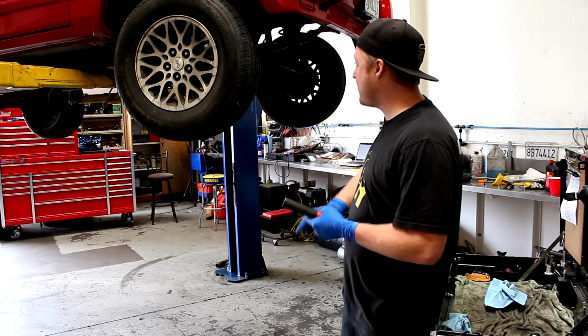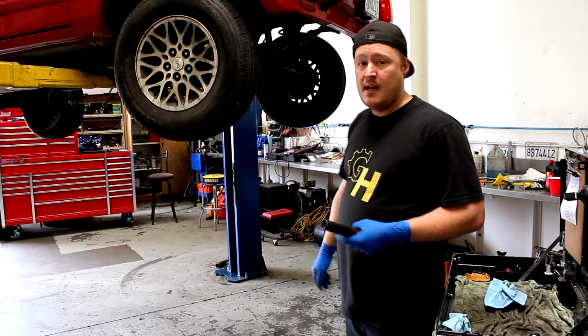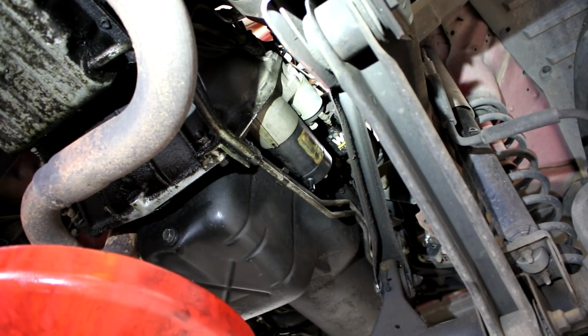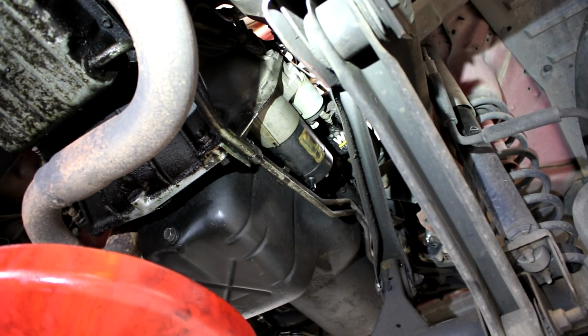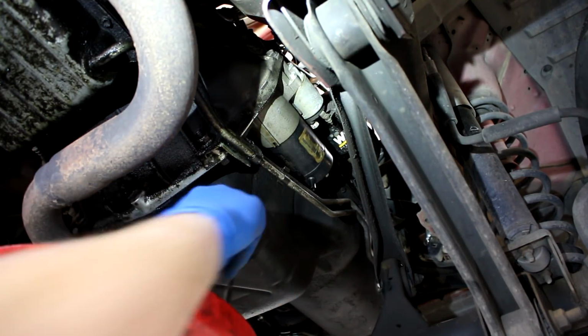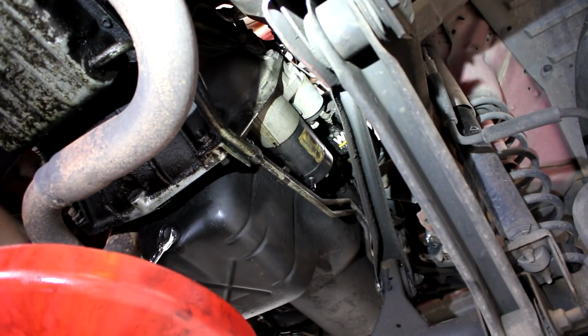So anyways, with that being said, let's go ahead and service this thing, and then I can get started with the other stuff it needs. All right, just make sure you've got something to catch the oil, and this one is a 5/8, or if you only have metric wrenches and you don't have a standard set, 16 millimeter will work.